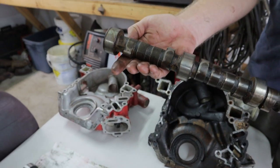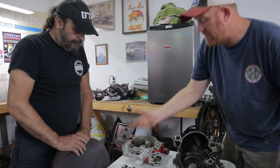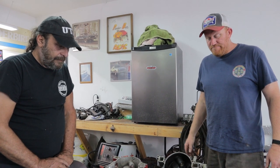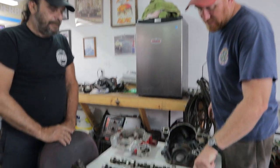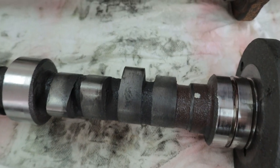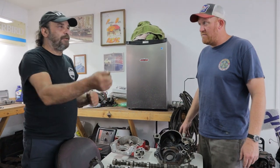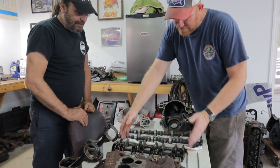What I found is every single one has a different number, and they all have a standard Buick part number. Some of them don't correspond to anything, so it could just be a blank with a casting number and no clue as to the grind. But you can just eyeball it real quick — go by the grooves up here on the first area, what would be the number one cam journal. Not many people are going to be looking for 60-year-old camshafts, especially Stage 1 or Stage 2, since they probably saw a lot of RPM and a lot less oil than they needed. But it's good to know what you're looking for when eyeballing parts.